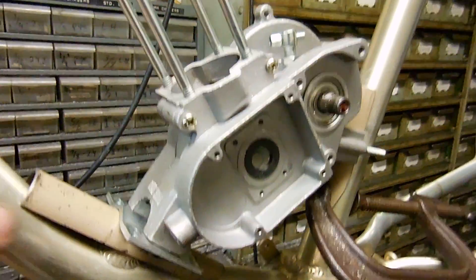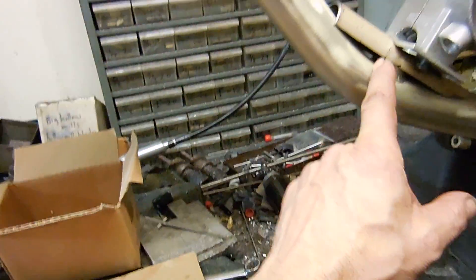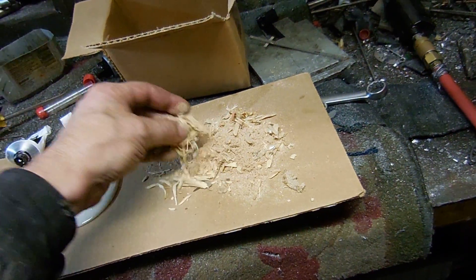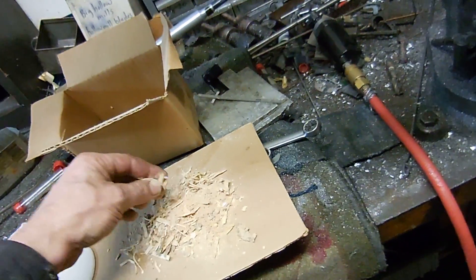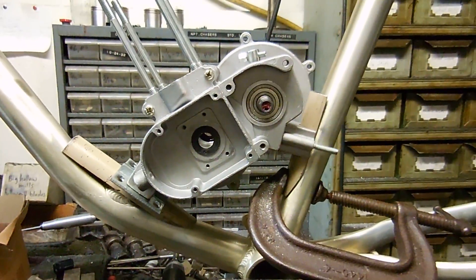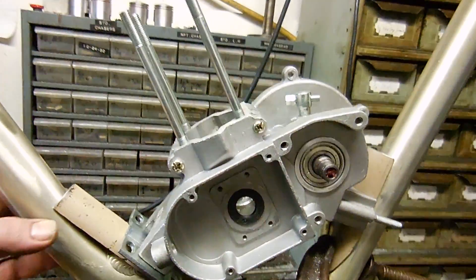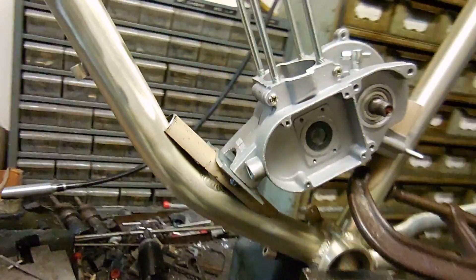You can see if you have big excessive gaps like that, I would suggest using some filler. This is like bedding material you'd get for pets, and some sawdust, some general debris — I'll take out the aluminum chip, but that'll be the filler to fill the big gap. We'll see how this whole concept works and you'll be updated on how the glue mount technology performs. This is something people can do with relatively primitive equipment to make a relatively nice mount for the engine.